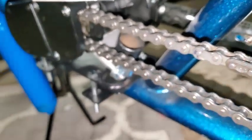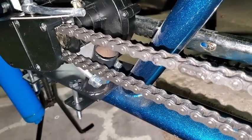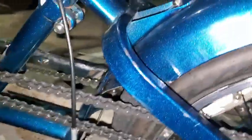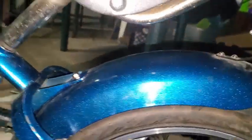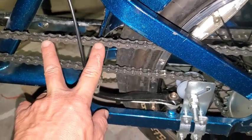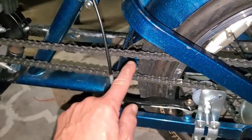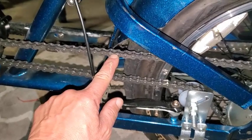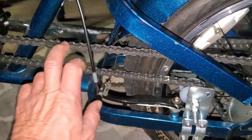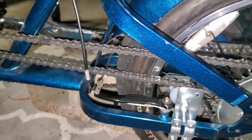There's not a whole lot of stud left coming out of that engine mount over there. I'm thinking about taking that off and at least putting some red loctite on there to keep things together. I did put some red loctite on these two — there are only two bolts holding this pretty hefty fender on the back. With the chain, I had to add about four links onto the chain that came with the kit. I think I added three and then had to add one more — yes, I'm pretty sure it was four links. That gave me enough chain to work with to make it happen.